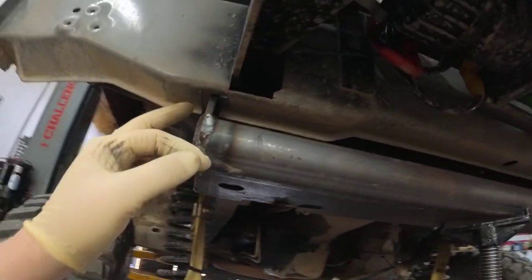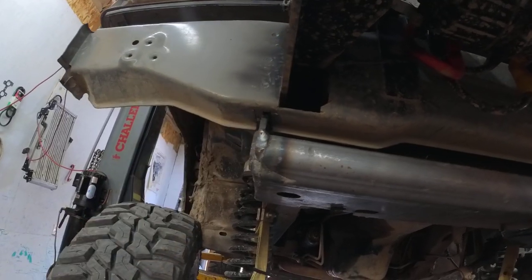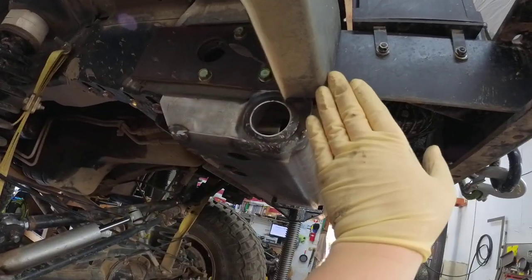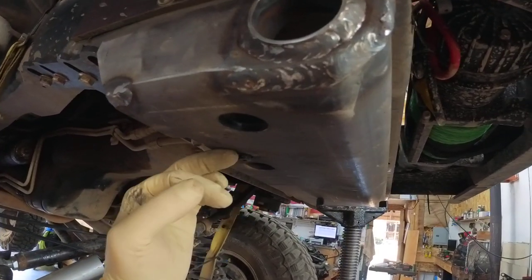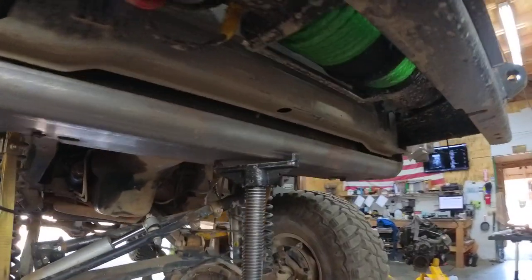Pop the thing up there — these are the only cuts you have to make, one on each side, for the ears to go through. You just mark it with a sharpie, cut it out with a grinder, then stick the thing up in there, put your bolts in, put your fish plates in, and put your hardware, which is all included. The only other thing I would suggest is to cut the locator pins off of the radiator so there's nothing to hang up on.